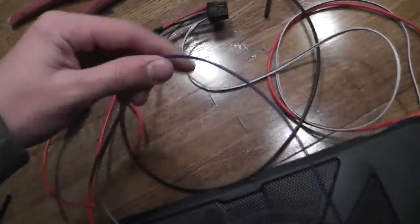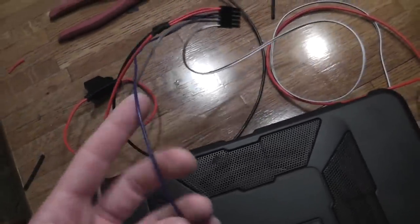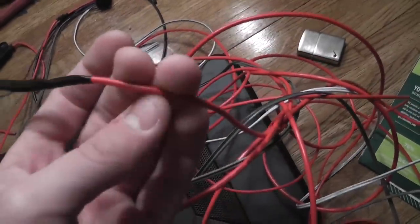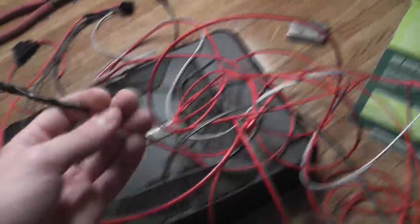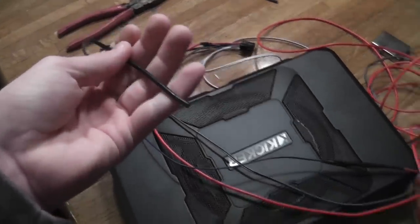Since I'm doing it this way, I have to connect this blue wire — the power wire from the clip — to the blue wire on the back of the stereo. It comes very short, so I had to buy a 16-gauge wire to make it longer. This black wire is just a ground — I'll probably ground it under the seat to one of the bolts.